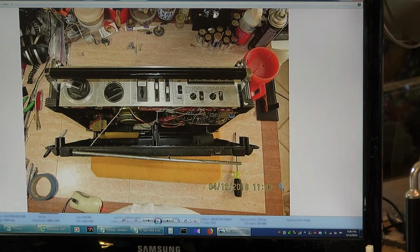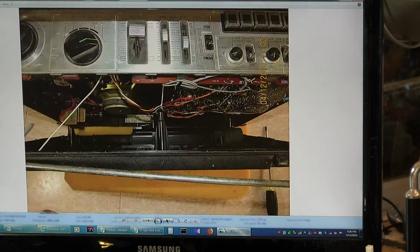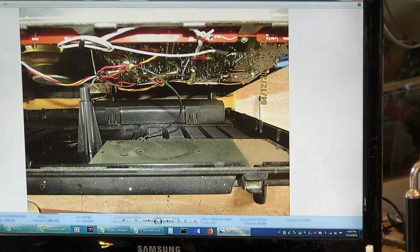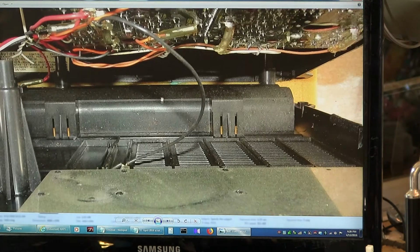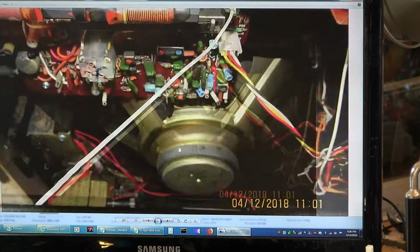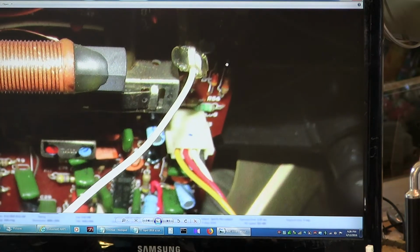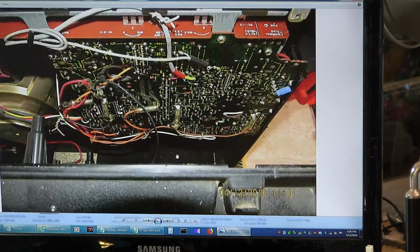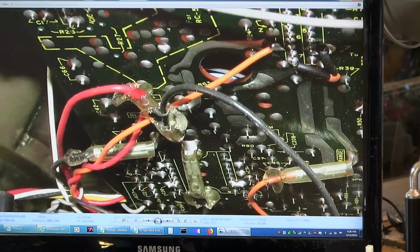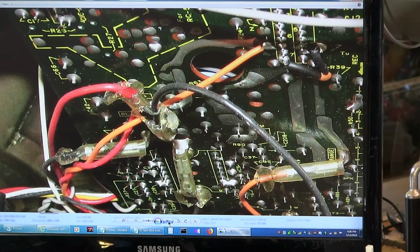And you pop it open, the back comes off like that. This is your antenna wire, the white one. It's very short, it goes right there onto the circuit board of the tuner. This is the negative wire from the battery, and then the red one is down there. We'll get to that. Again, it just plugs in right there on the motherboard of the tuner.